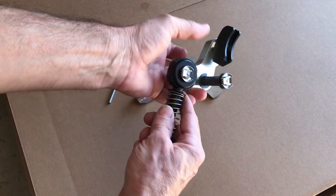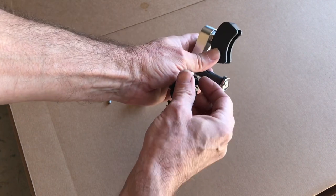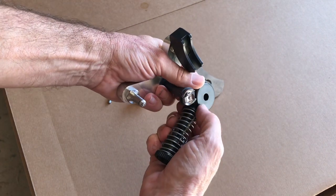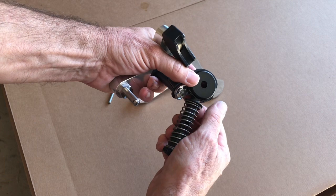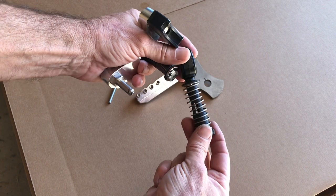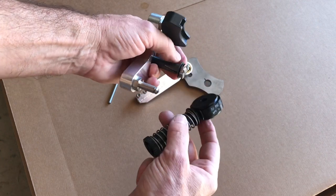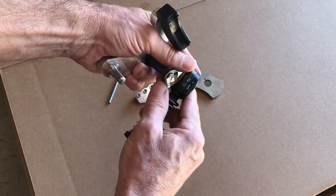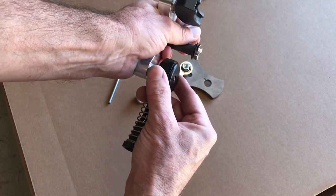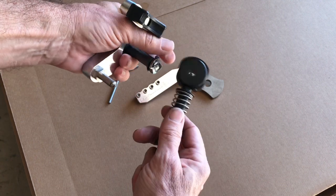The other thing we've done is switch from the billet aluminum cable end on the side to side to a set of inserts for your stock cable end. The inserts are made to fit the cable end perfectly. The cable ends are very durable in the side to side direction — they're under almost no load whatsoever — and we built these parts to have zero clearance, meaning there's no slop in them at all. The pins are custom and the bushings are custom, made to fit each other perfectly. It's very precise.